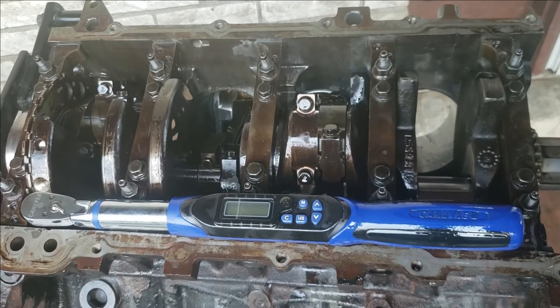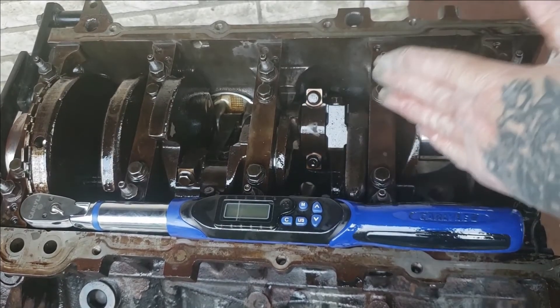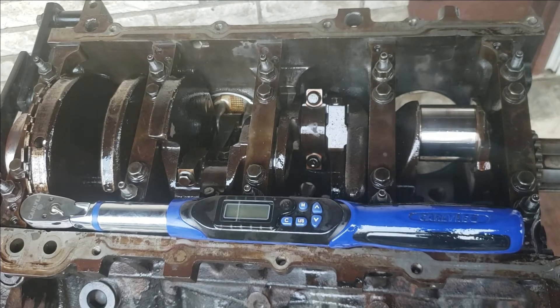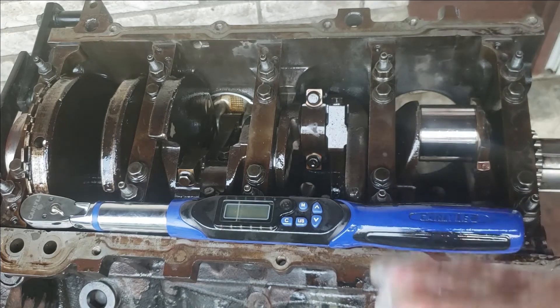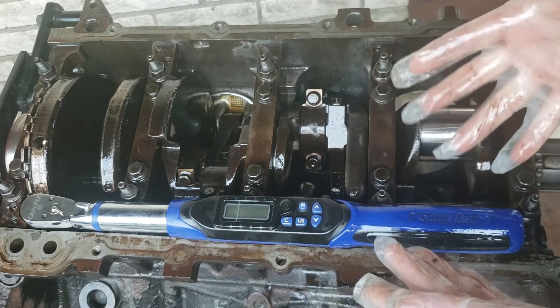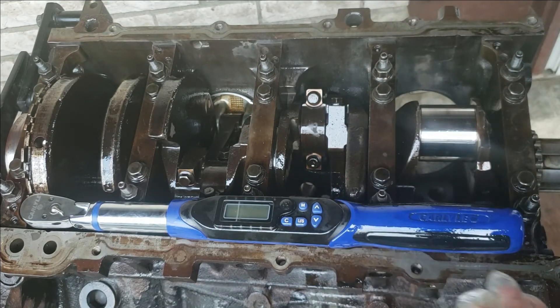Let's go ahead and turn this crank over. I like to install one piston and always spin it over to make sure the engine spins each time, because you don't want to put all your pistons in and have one of them backwards so the motor won't spin. If you do it one at a time checking as you go, you know which piston it is. If you put the other piston in and it don't work, you know that's the one causing trouble.